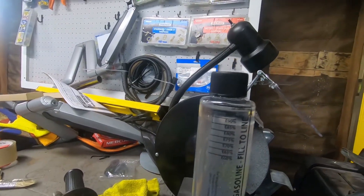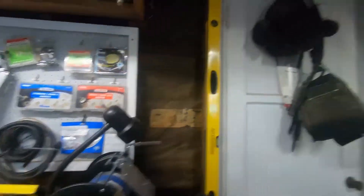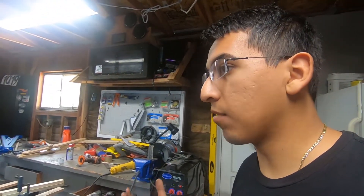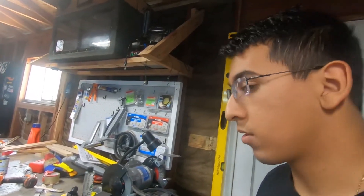So far it looks like it is staying pretty steady to 85%. Shows that we still got good E85 in the car, which is actually amazing. I thought E85 likes to draw in a lot of moisture, but it just goes to show — since we have been having pretty dry days here and it's been hot — it has not been pulling in very much moisture into the tank, and our E85 is still good.